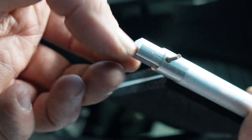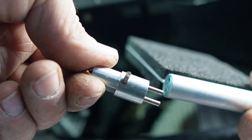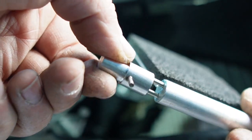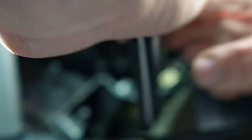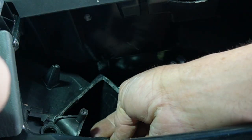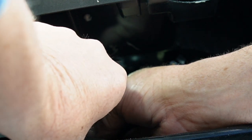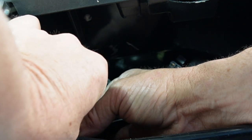This one with the flat two sides on it — this little thingamabob here comes off and we got like a little corn holder tip. We'll pull that off so we can get this blend door in here. We'll just shove that end into the other blend door shaft and line that up, then put our little corn holder spikes in there if I can get them lined up.